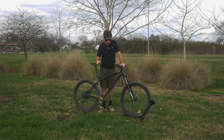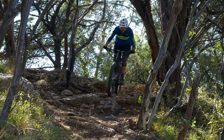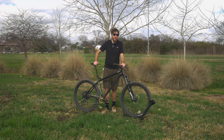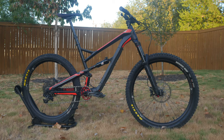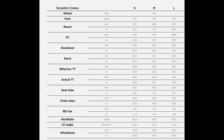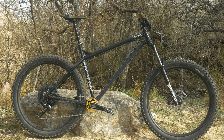Let's go ahead and talk about how this thing actually rides. I've had this bike for two years now, and it's an absolute pleasure to ride. Steel frames aren't as stiff as aluminum bikes and they offer a little bit more flex, therefore the ride quality isn't as harsh as an aluminum hardtail. I actually preferred riding this bike over my old YT GFC, and to this day I still grab it for most local rides. It has a 65 degree head tube angle with a 74 degree seat tube angle and 475 millimeter reach in size large. While those numbers aren't as radical as some newer steel hardtails like the Marin Elroy or the Norco Torrent, I think this geometry is a little bit more well-rounded, and to me it feels really good.